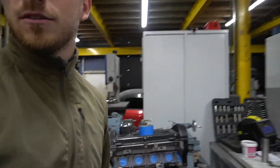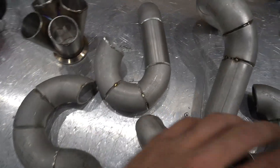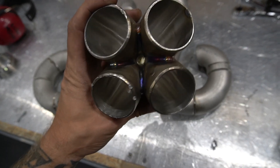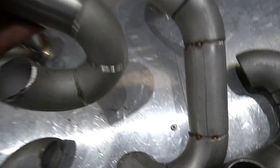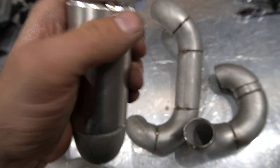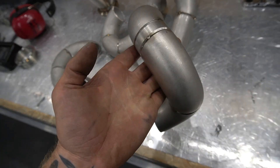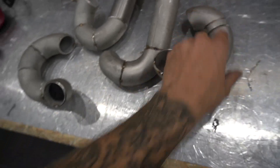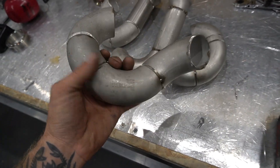Today we are throwing together the manifold for the TT. As you can see it's been sat on here for a while — it's no longer on there. I'll have some before footage of how all this looks before it went in the vapor blaster. I've now untacked all my manifold — this is the collector, all welded up nicely, ported inside, looks great — and it's still got all the scale on there from the factory and loads of roughness. I want it all one uniform finish. You can scotch bright these by hand, wire wheel them in the pillar drill or on a drill, but because I have a vapor blaster I'm going to throw them all in.